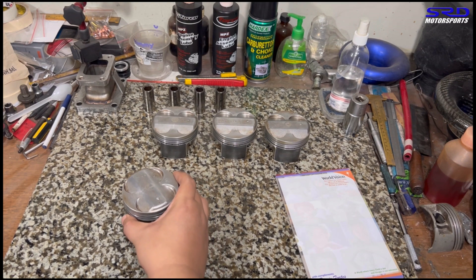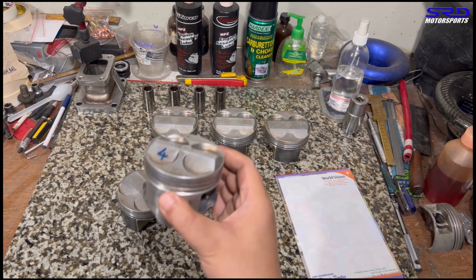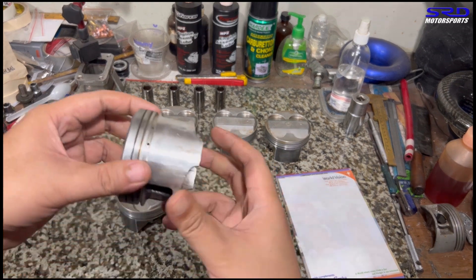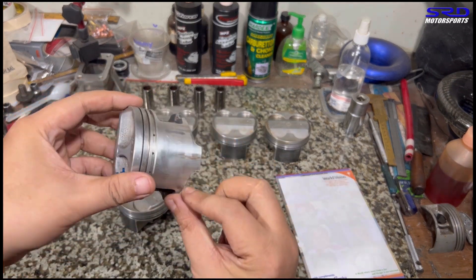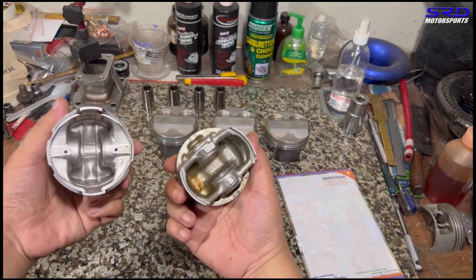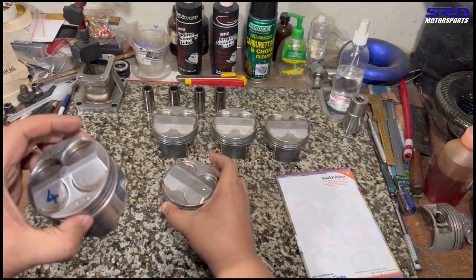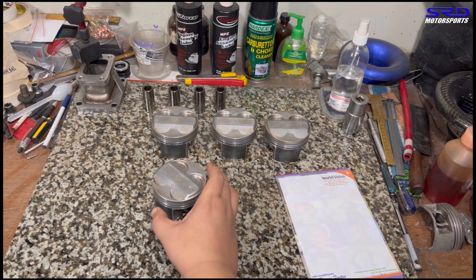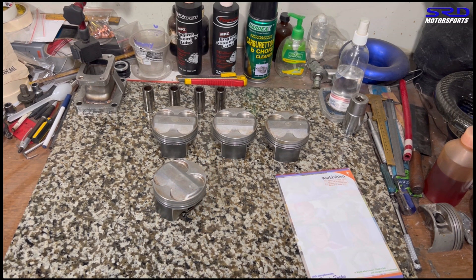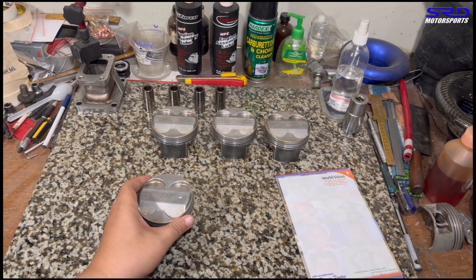The Honda alloy for the stock pistons on the K series is a lot better than the B series and D series. I feel it's closer to hypereutectic pistons because the material is more closely packed. You can see on the ITR and CTR pistons the bottom is still full circle compared to the K series, which is narrower — and that means less friction, more power and efficiency.